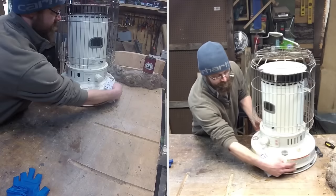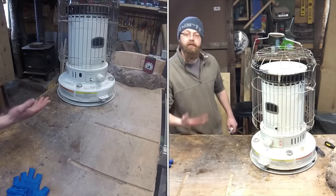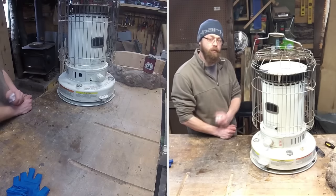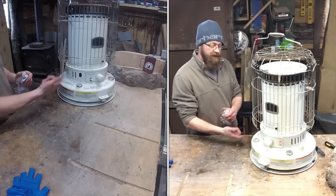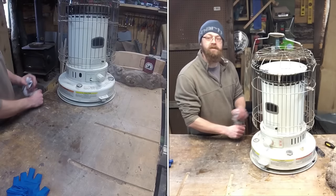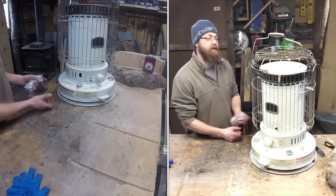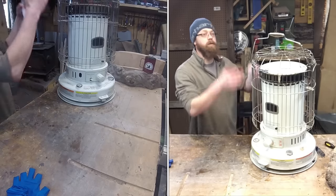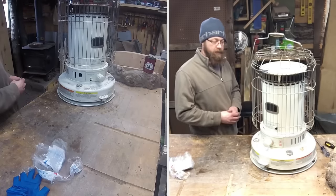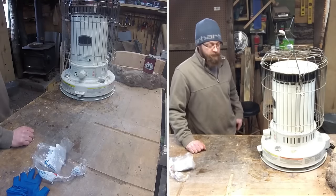That's it — pretty simple job replacing the wick. Let it sit for a few minutes to absorb kerosene. I already have kerosene in mine so it's already starting to soak into the wick. Maybe five or ten minutes — check it and see if it'll ignite. Make sure you don't have kerosene all over the unit from swapping things out, so wipe it down and clean it off. Always start these things outside, let them burn off and warm up, and make sure they're not bellowing smoke before you bring them in. If you're having a hard time lighting it, that could just be due to not enough kerosene soaking into the wick yet.